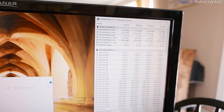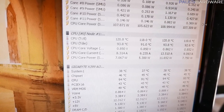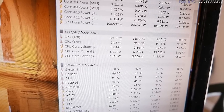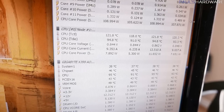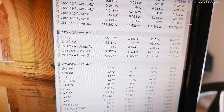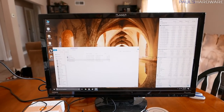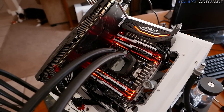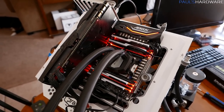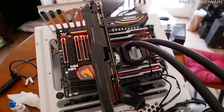Looking at HardwareInfo64 and our initial CPU temperatures — looks like we're at a nice chilly 93.3 degrees Celsius, and it appears to be climbing fairly quickly. 94, 94.8, 95... The Corsair H100i doesn't seem to be doing a very good job keeping things chilly. You know what happens when temperatures keep climbing? That is called Thermal Junction Max — TJ Max — and the system just shut itself off to prevent the 1920X from being damaged.